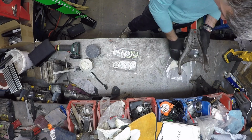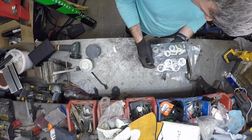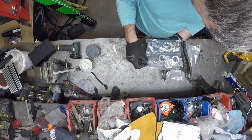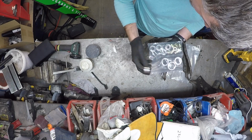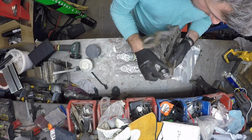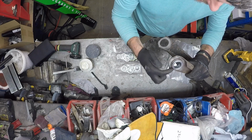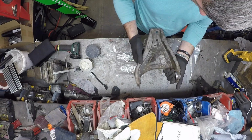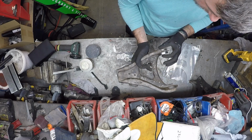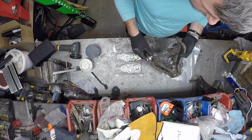What else do we have? It's a Pure Motorsport bearing kit. So instead of bushings, we're going to be running bearings in them. So I need to take this, and this needs to be welded like so, somewhere around here. And it's obviously going to be caster adjustable as well with different shims, so you can go either left and right. So let's get cracking.